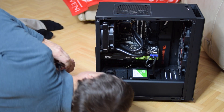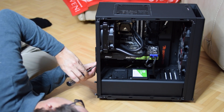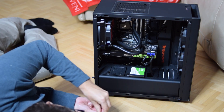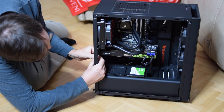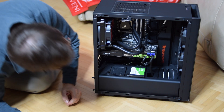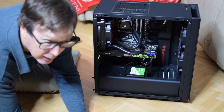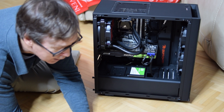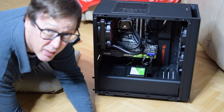Confirm the alignment — yep, it's going to be this one. We take this screw out and we take this bracket out, because this card is actually going to take the place of that. A couple of things: don't do this on carpet. You should wear one of those static wrist straps that's grounded, and make sure you don't touch any of the metal parts on the motherboard or on the card itself.